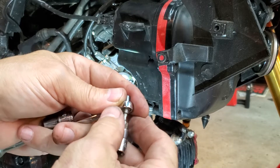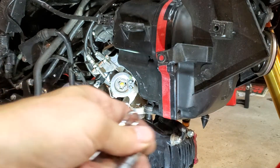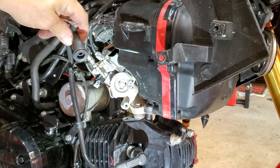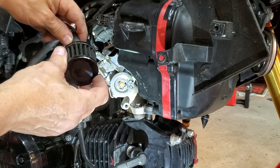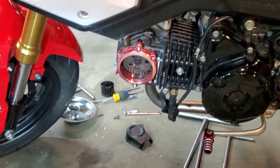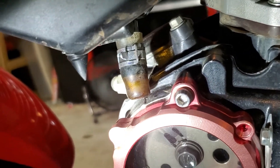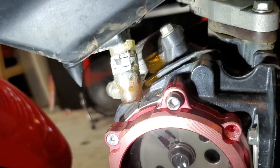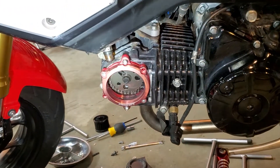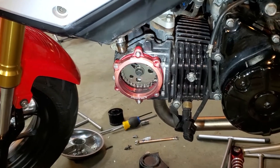However, if you're having to really far adjust this screw, that means you've got something else going on. It could mean your air filter needs replacing. It could mean your little crankcase breather — this bike has a little breather filter on it — could be clogged. Your crankcase vent, which is on the other side — see that little tube right there? That's your crankcase vent, and if it is filled with fluid, it needs to be drained out. That's a good thing to investigate and service frequently.